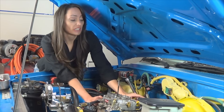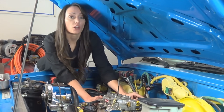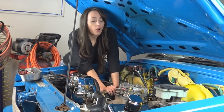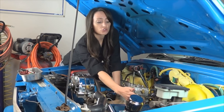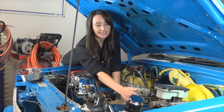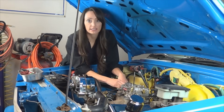As we found out, the rotation is clockwise, so the firing order needs to follow that rotation. With the small block 350 engine, all the odd numbers are on the driver's side of the engine, which are 1-3-5-7. And on the passenger side, you're going to have 2-4-6-8.